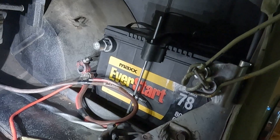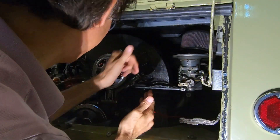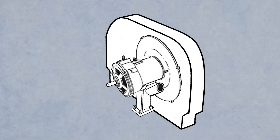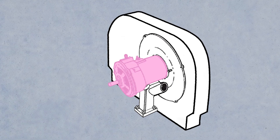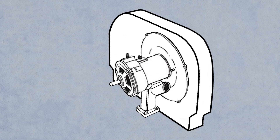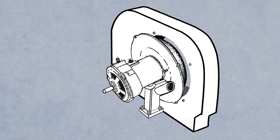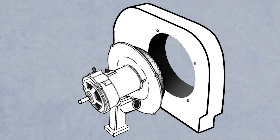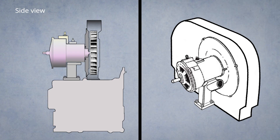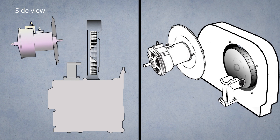The first thing was disconnecting the battery, then remove the pulley and the belt. We remove the right side air cleaner to make the back of the shroud accessible. There is very little space between the fan shroud and the alternator. The alternator is attached to the backing plate and cooling fan — if we pull the alternator, the backing plate will hit the stand, and the fan will hit the top and bottom of the hole on the shroud. So unless we detach the stand from the base and pull them together, we can't get the alternator out. But if we separate the alternator from the cooling fan in the shroud, we can take the alternator out.